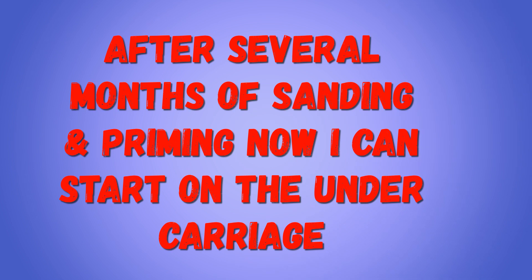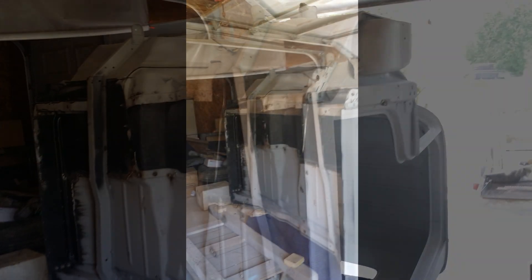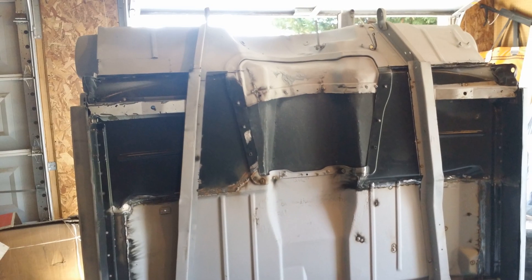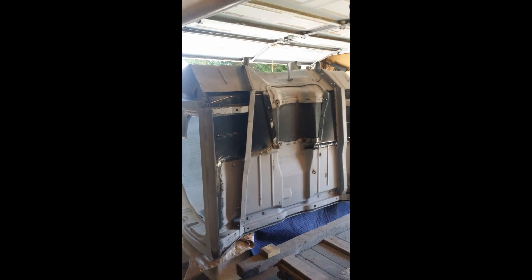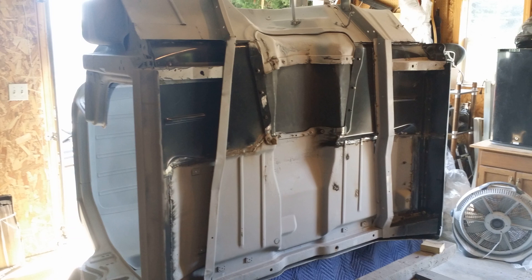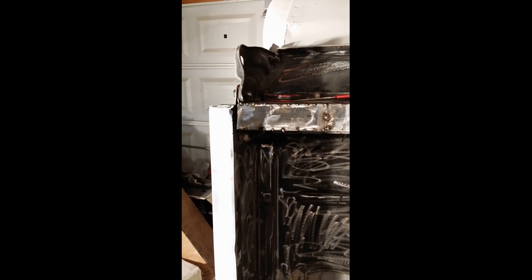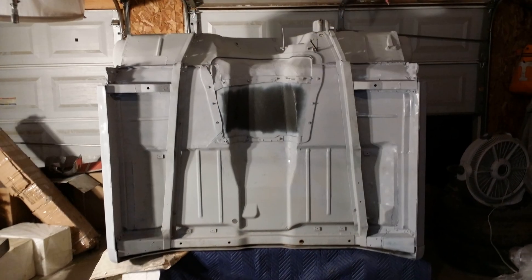After several months of sanding and priming, now I can start on the undercarriage. Believe it or not, this is actually one of my second best things to do - prepare and treat the undercarriage of the truck. I actually found this product called Raptor Liner and it is far and none the best. Easy to spray, it lays down very good and it has a texture that leaves a good protection coat for your truck underneath - because all of the rocks and grime are going to hit up from the road. So it protects your truck and it also looks good even though you won't see it because it's underneath.